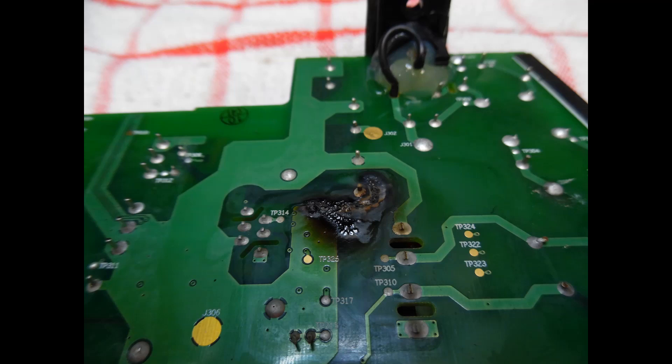You will see this on any of these Sonos units - it may not always be this severe. Sometimes with electrolyte leakage you can cut out a small section of the circuit board, fill it with epoxy resin, and make good with a wire connection. However, the level of damage on this board was so severe that was not an option. The only solution is to source a donor board - a common approach in iPhone and Apple device repairs, where repair companies use multiple circuit boards as sources for donor components.